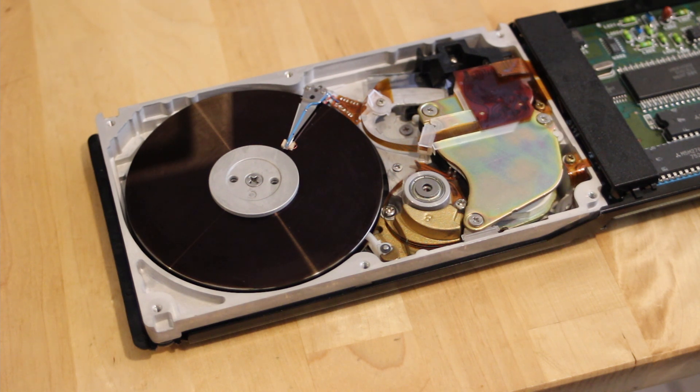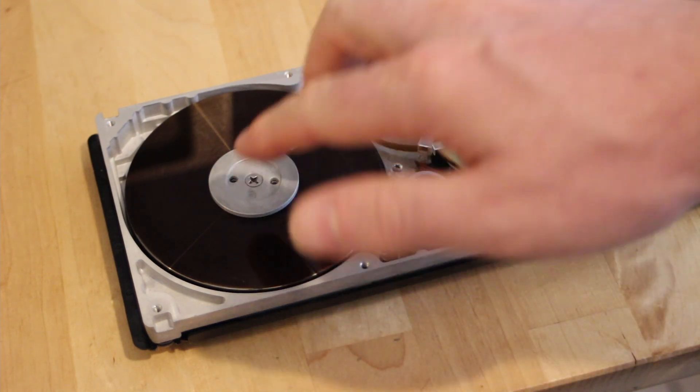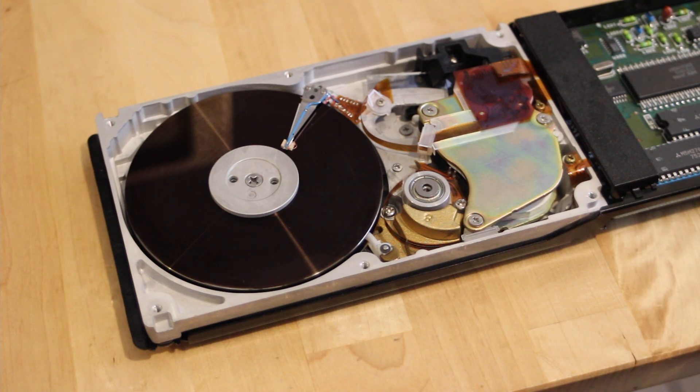I did clean off the platters and a lot of what appeared to be really quite awful scrapes just wiped off — they were just bits of dust and oil that had spread out over the disc. So hopefully you enjoyed this little look at the surface of the disc, how to disassemble it, and some ideas about what might be going on here. Also this finding that the motor itself is not stuck — so there's really not a whole lot of point taking these platters out to try and oil the motor. I'm going to put this drive away before I actually do some real damage that can't be reversed, and look at it again at a later point if I come across any more information. Don't forget to like and subscribe if you liked this video, and hopefully we'll see you in a later video. Bye.